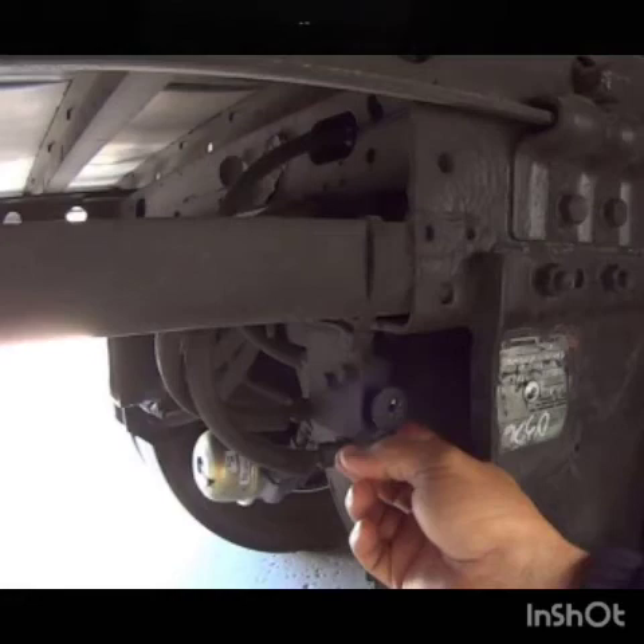If you have that air valve system on your tandems and there's not enough air — when you pull that pin, all your locking pins don't go in, there's no air release, and you don't hear a hissing sound — that means you need to drive. That's going to be the best and most cost-effective way to be able to slide your tandems.